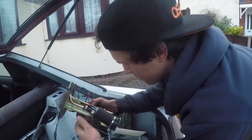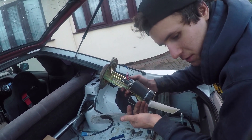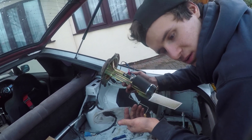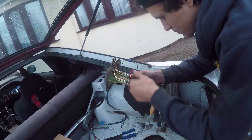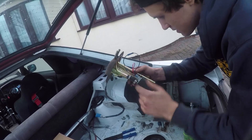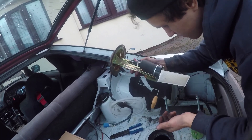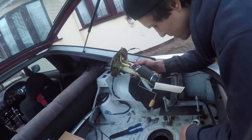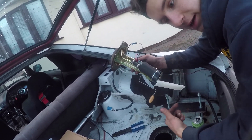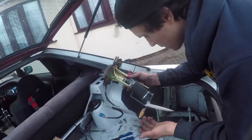Just get the jubilee clips, whack that on, and stick it back on the rig. We've got the new fuel pump on here — it's quite long, longer than the other one, but this is a 450 and most of the time people put the 255 Walbros in, so it's probably bigger. We got it in, got the wiring done — just a couple of crimp connectors and some spade fittings, a little bit of hose which feeds the rail at the front, and the little sock is on. Now we just have to feed it back in and you're pretty much good. Your fuel pump's installed — just plug the connector back in. In our case we're going to relay it, but that'll be in a different video where we'll explain what relaying is. That's how you install a fuel pump — it's that easy, and everyone forgets about it.